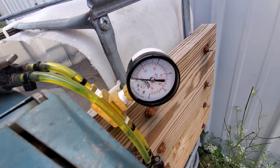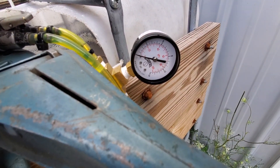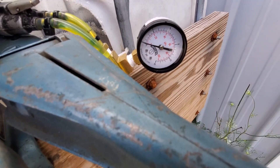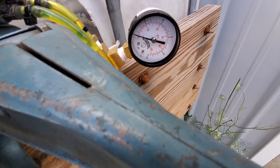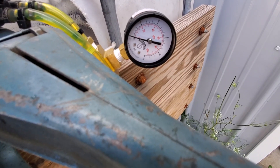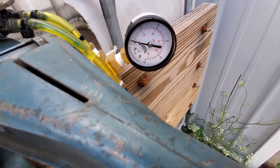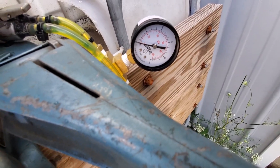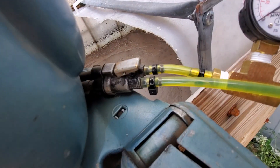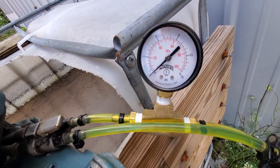The pressure went back to zero when I released the tank. I tried this previously on a 1959 10 horsepower Evinrude and got about the same pressure — it seems to be about where these things run, around 3, sometimes as high as 4. I don't know what the pressure relief valve is supposed to be set at in these tanks, but I think it will probably allow pressure to go up to around 7 before it releases. Sometimes in the sun it'll build more pressure than what the crankcase provides. It's just built with a tank fitting on one end, a motor fitting on the other end, and a T with a low pressure air gauge in the air line.